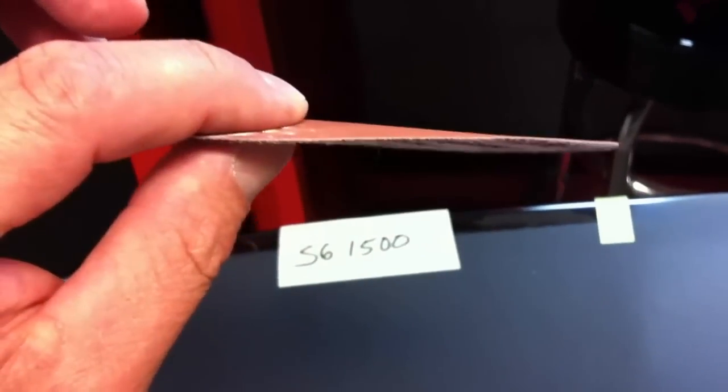anything on. And to do this test I started out by sanding this entire panel down using the Meguiar's Unigrit 1500 grit sanding disc. Now this is not foam back, so this is purely for leveling surface texture and removing orange peel. And then I taped this off. Everywhere you see one of these thin green lines is where there's actually a tape line to mark off the different quarters. I broke this into 4 sections. So I sanded the entire panel with the 1500 sanding disc.